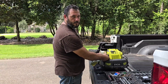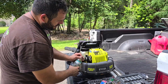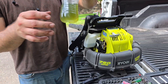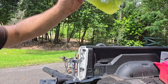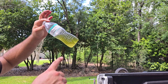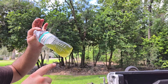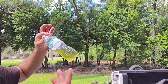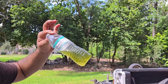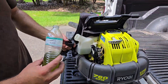This is one of the most common problems with gasoline engines that sit for a while — this one sat for about six months. Also, sometimes rainwater gets in the ends of gas cans; those newer ones with the secure lids will fill up with water, and that's how you get water in your gas. If this doesn't fix your problem, there's a chance you could have a carburetor issue — the next video will show you how to clean out the carburetor. If there are any other tips or suggestions you need, leave a comment below, and if this was helpful, make sure you subscribe. We'll see you in the next one.